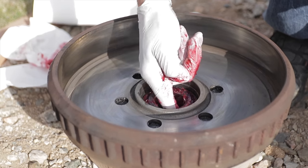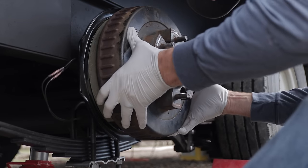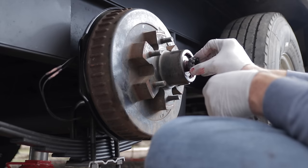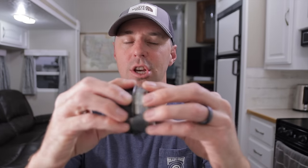Once we put a little grease on the inside of that drum, we drop our inner bearing in there just before we put the seal on. Now that's assembled, we can install the drum. I like to add a little bit of grease in case the bearings need to pull it in, then we put in the outer bearing — you don't want to overdo it, but you want plenty of grease. Then we put in the washer and the castle nut. Torque the castle nut down to 50 pounds and spin the drum to seat the bearings, then back off the castle nut so it can spin freely. Put in the cotter pin so the castle nut can't come off. Finally, put our caps on to keep the grease in and prevent road grime, dust, and dirt from getting to the bearings.